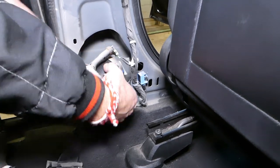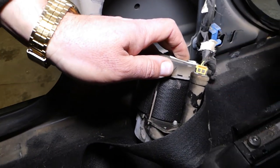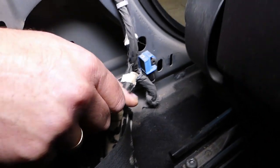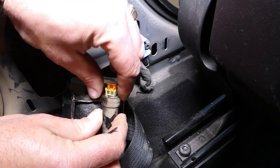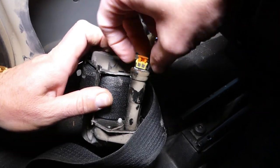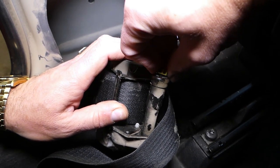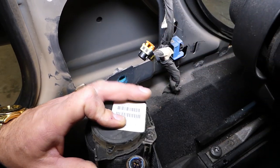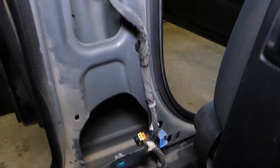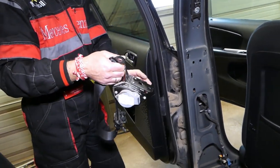Now we pull the belt out very carefully. This is your airbag connector right here. To disconnect it, I wouldn't recommend using metal tools — find something small and plastic. If you don't have any, pry it up like that, then grab and pull straight out. Do not twist — never go in at an angle, never twist. You have to go straight out, otherwise you're going to damage your pins and your connector, and those things are expensive to replace. This is the belt out of the way — that's how you remove it. Thank you for watching, please subscribe to the channel for more videos.